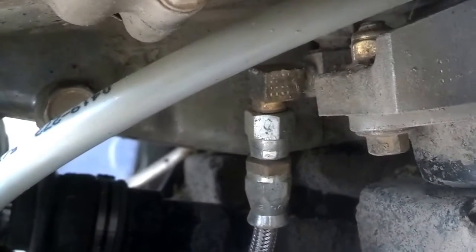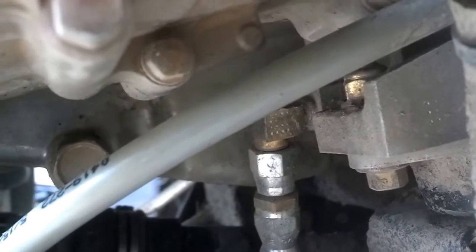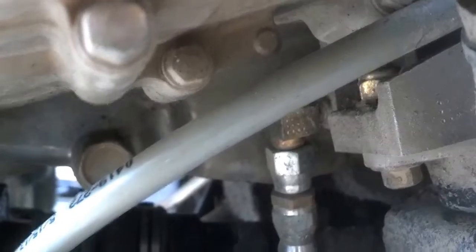Up in here I've got an oil pressure sender and a low oil pressure shutoff that I've wired in. I've got a braided cable line that comes all the way down underneath by the engine mount that goes into where there was an actual low pressure light switch, but it wasn't wired into anything. So I've placed that all in there.